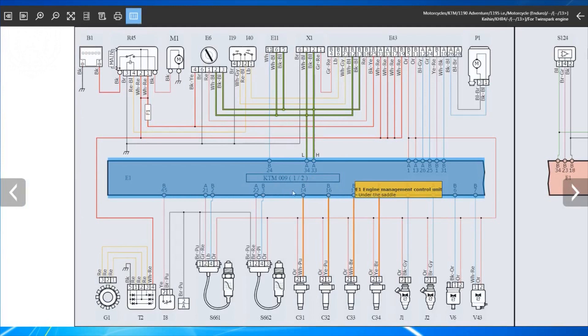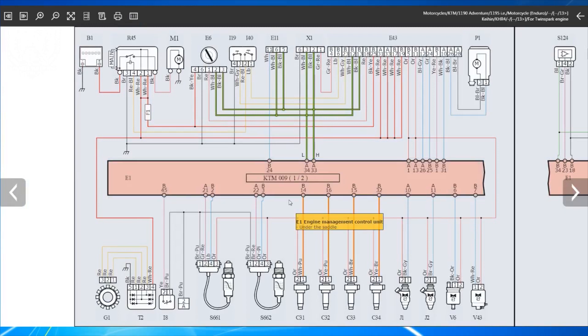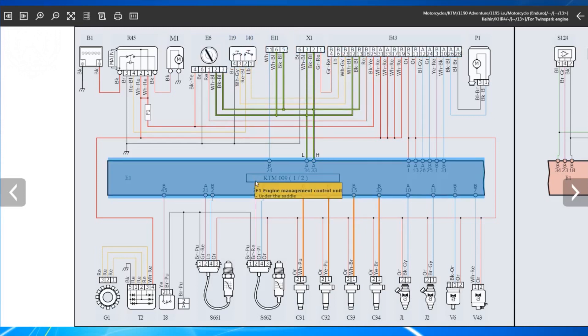There's an order of importance for each of these modules. To summarize: the cruise control was causing a load of noise on the CAN network, causing the engine management control unit to reset itself, which then meant I had to go in and re-initialize the gear position switch. I've reset ECUs on these KTMs before - on 990s - and never had that problem. It's always simple when you find the fault. That's the fix. Hopefully that wasn't too much of a waffle and there's some information in there you found interesting.